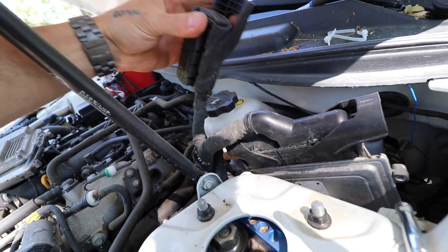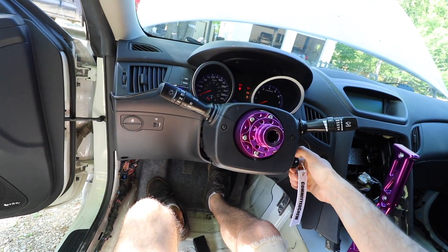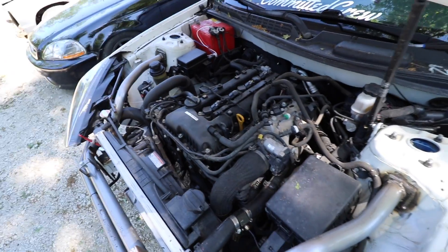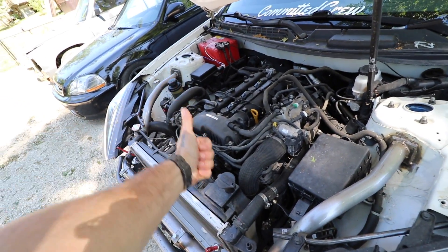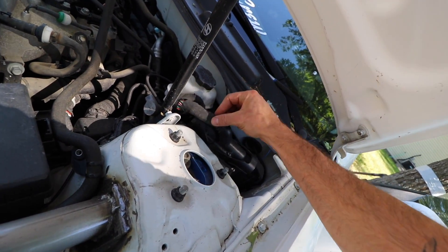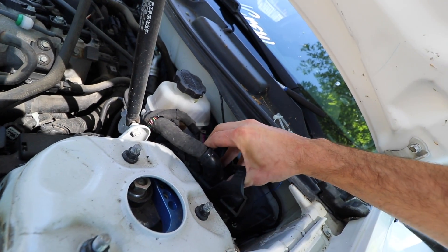So now I got this auto plug doing absolutely nothing - I feel like we're still gonna have problems. We start it up and - that's what I thought was gonna happen. It's not even starting because the clutch has no plug. I just didn't think this one through enough. It's not worth doing because the car needs a manual harness - there's a wire that gives the signal that the clutch is depressed and those wires don't exist without the manual harness. So along with the ECU we'd have to grab the right harness, which just ain't gonna happen. Out comes this boy.